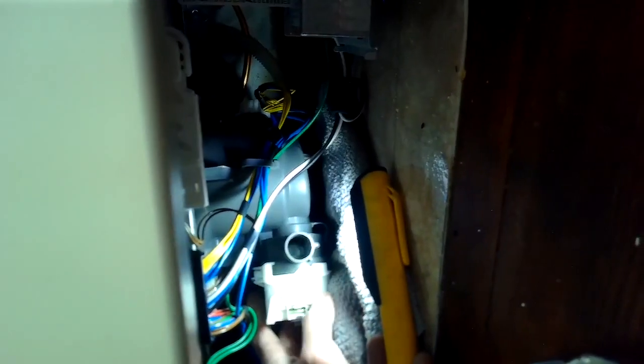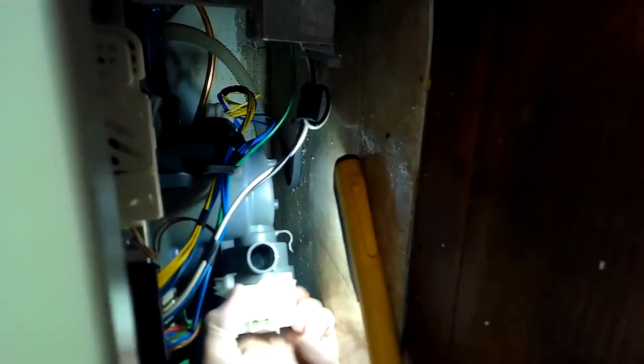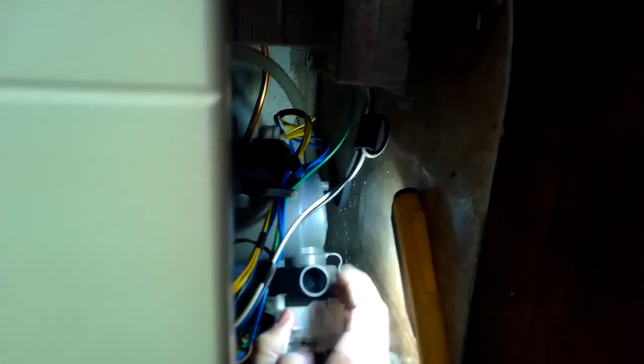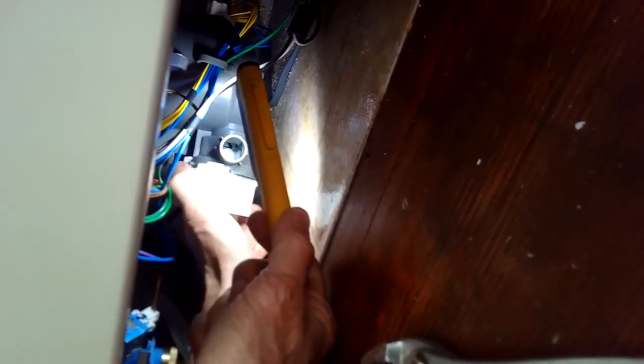I think what I'll do is remove this little drain motor and see if there's something caught in that area. To do that I just have to remove the little power connector — there's a tab I'm going to push down on and then pull it out. Then I need to turn the whole drain motor counterclockwise, to my left away from me. There's a little catch that I'm going to release that holds it back, using a small standard head screwdriver to pry back on that release. Then I'll grab that motor and turn it away from me to my left — counterclockwise from the front — and that lets it go.